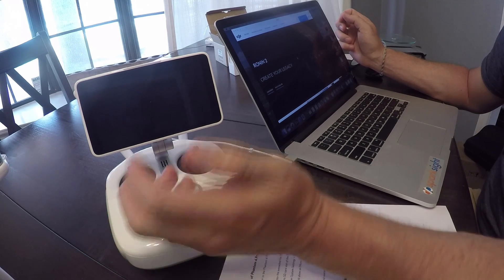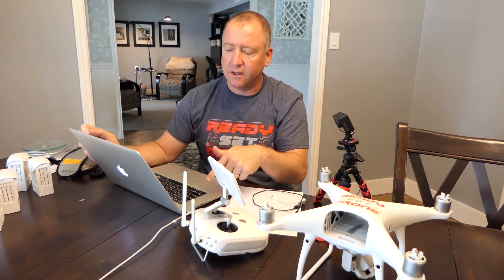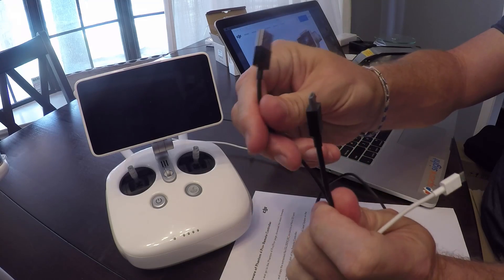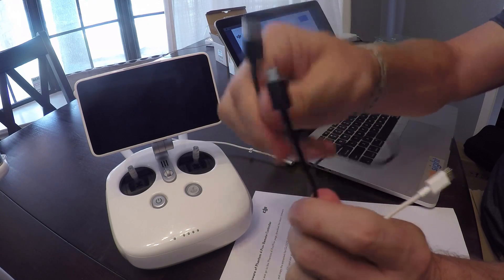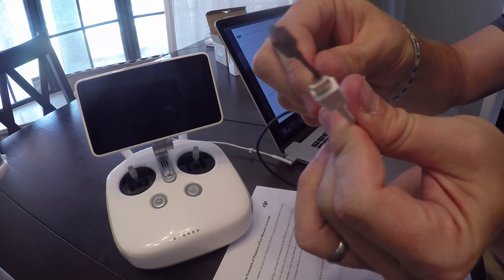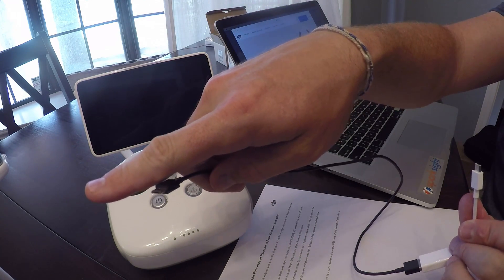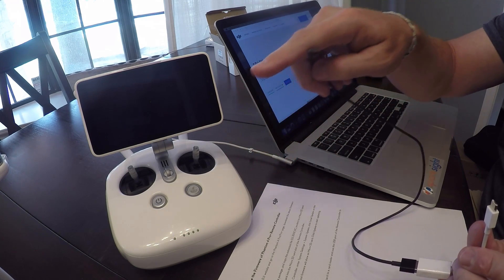Basically what I'm going to take you through is how to update the firmware on your remote. If you are updating the drone using DJI Assist 2, that is a fairly straightforward process — you just connect the drone to the computer. Keep in mind that when you connect your drone to your computer, you need a micro USB plug and then a full-size USB plug for the computer, unless you've got one of those fancy new MacBook Pros and then you need an adapter. Basically, this is the cable you need. When you're connecting your drone to your controller, you need this little adapter that comes with your Phantom 4 or Phantom 4 Pro. For a while, I was trying to plug into the full-size USB on the remote control and that does not work — that is for something different, not for doing updates.